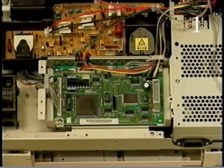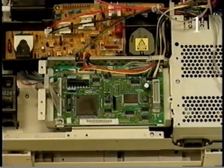Immediately after switching on the printer, the DC controller conducts a self-test to determine if the necessary ready states exist. If all ready states exist, the DC controller initiates a print cycle. The I/O controller then sends a bitmap image of the user test page, stored in ROM, to the page buffer where it is held until it prints.